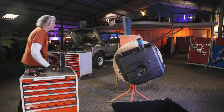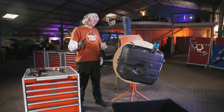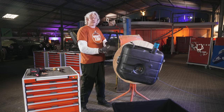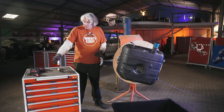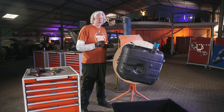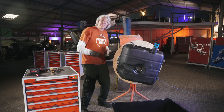So now our brand new fuel lines are connected up — we need a fuel tank. Ever since I mentioned that I was going to come up with a way of automating the cleaning process, loads of you suggested a cement mixer. So here it is. Because the tank is so big it wouldn't fit inside the cement mixer, so I had to contrive an apparatus so it could hang off the front safely for a very long time. Because all the bits and pieces inside would be spinning around I thought I might as well get rid of any extra bits we didn't need — so I cut off that old sender and got rid of the rest of the old fuel pump as well. This thing has been spinning for just over 12 hours and I'm itching to find out if it's actually done the job and stripped away any excess rust inside our tank. The only way to find out is to get inside, but first I need to drop the fluid.